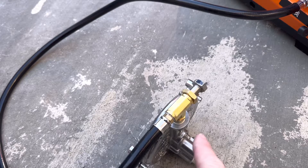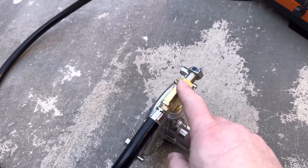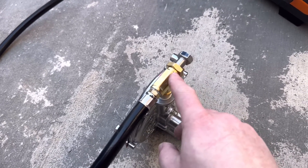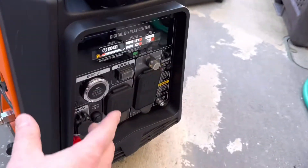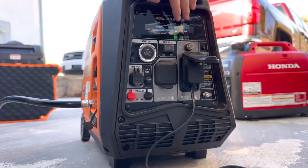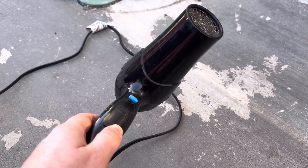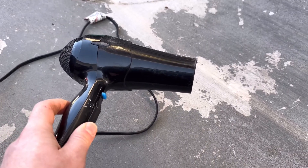Now that the generator is running, you'll need to make an adjustment on the load block on top — it acts like a manual fuel screw or jet size adjustment. You need to do this while the generator is under load so it's getting enough fuel. Hook up a load — about 1,500 to 1,600 watts is good for demonstration.